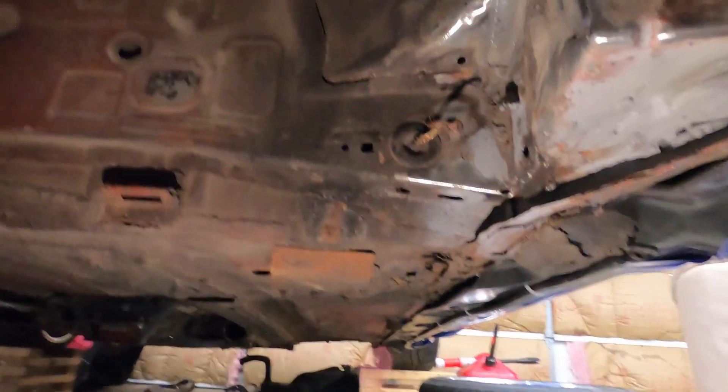So I spray-painted one side of this as well as the underside — it's called a weld-through primer, so you're supposed to be able to weld with the paint on it. Because this side is going to be all sealed off, you won't be able to paint it once you're done welding. So it's just to help with corrosion in the future. I'm going to go put those up in there and start welding.